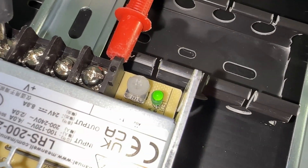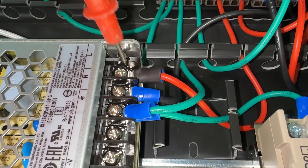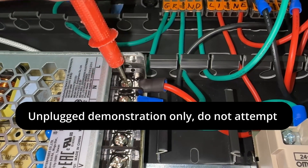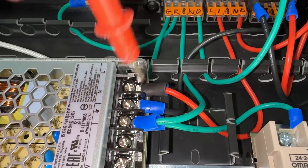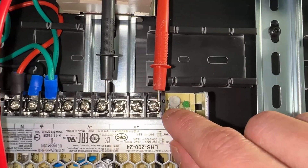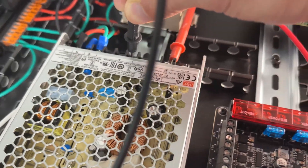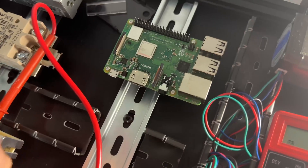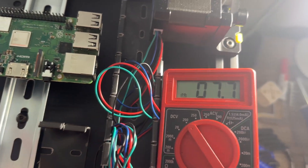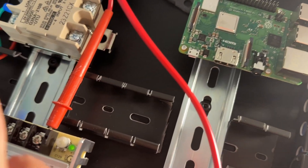If you want to test the input voltage, remember to switch the multimeter back to AC mode, and be mindful of the probes while gathering readings. The housing of the PSU is an exposed metal ground that will spark if accidentally contacted. If you have clumsy or shaky hands, I used the method of screwing down the probe. After you power off, the green light slowly dims as the voltage drops to a safe level — this represents the capacitor discharging. Once completely off, you can work safely.